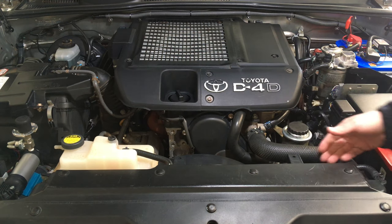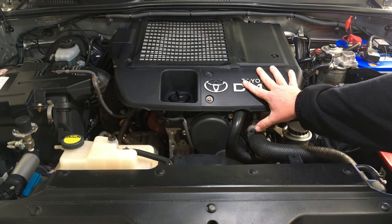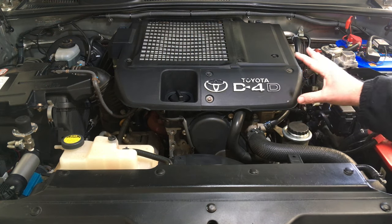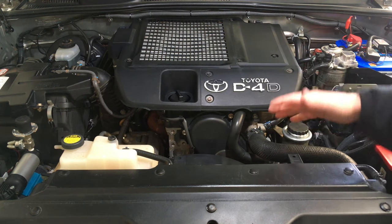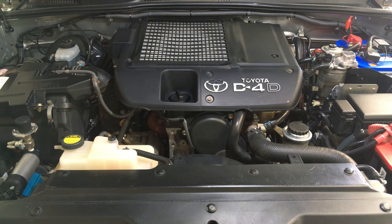The reason it's a hose is because the cooling system is in a fixed position. The engine is on engine mounts — it can move a little bit — while the radiator doesn't move. So the hose is there to allow that movement. There's a little bit of movement going on there, not a lot.